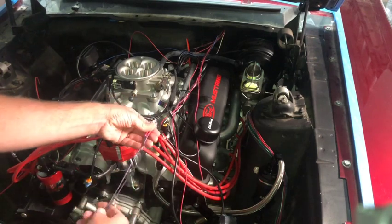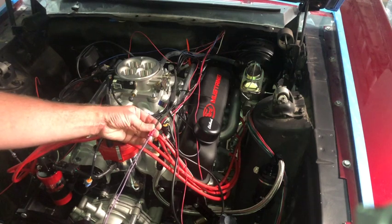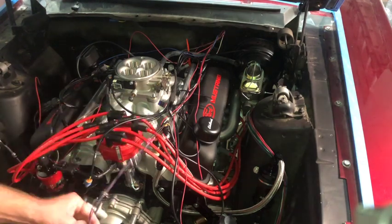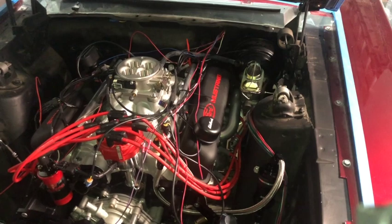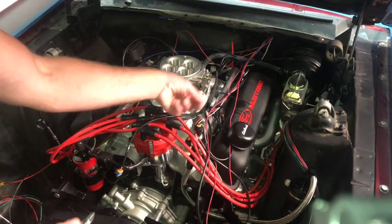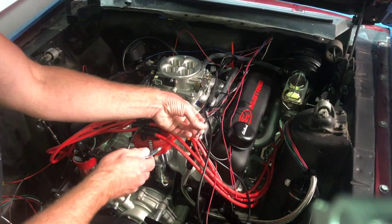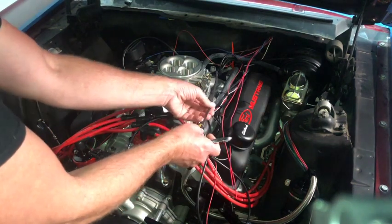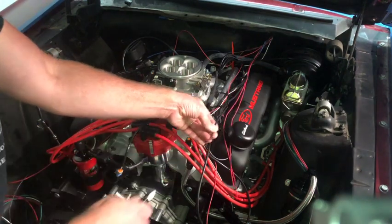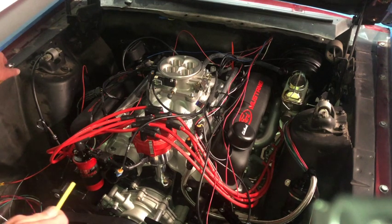Okay, so that's good there. My big concern here is waterproofing this. So I think I'm gonna grab some heat shrink that I have and put that on there. All right, because I decided to heat shrink this, I had to cut off those butt connectors and the pigtail because it wouldn't fit. The other thing I noticed is that this connector was a little bit longer. I'm gonna just cut them even, and I think it'll be better that way. So got that, and I put the heat shrink on now.